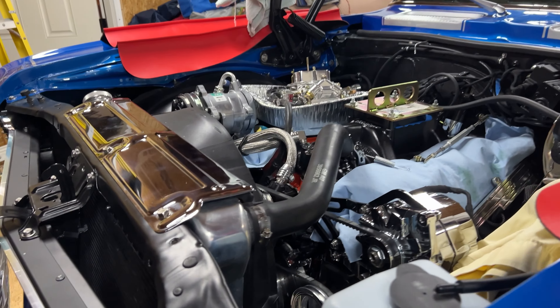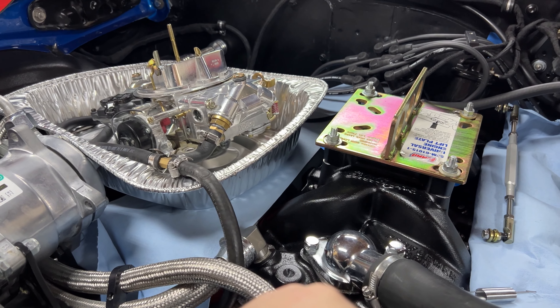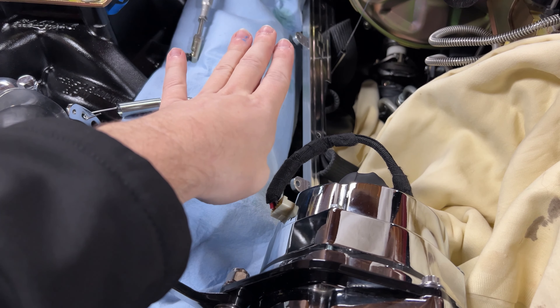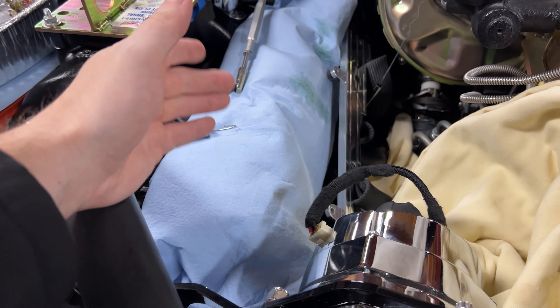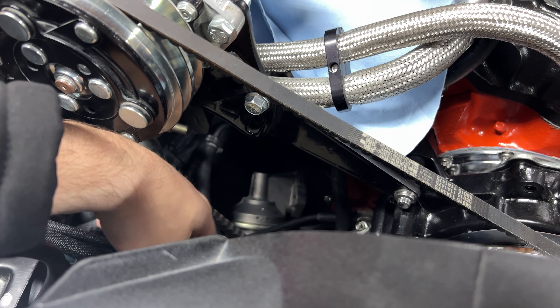To get this swap done we did have to take apart a good bit of the engine. We had to take the carburetor off to put the lift plate on, unmount the headers on the driver's side so they wouldn't interfere with the engine lifting up since they wrap under the power steering box. Valve covers had to come off to give room to raise the engine up at an angle since it's still connected to the transmission, and we had to take the fuel pump off because we couldn't get to the engine mount bolt on that side.